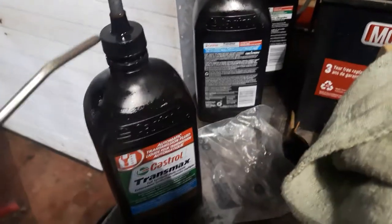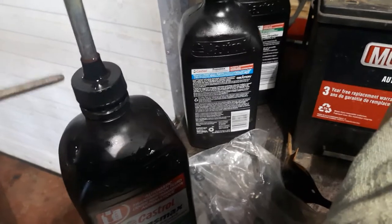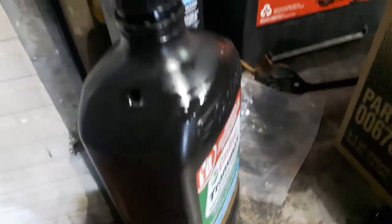All you do is take the lid from a gear oil bottle that has a small little spout, cut it off to fit a brake line in. There's a little hole in the side that you can fit an airline into. I've already filled this transfer case, but...